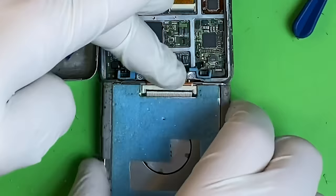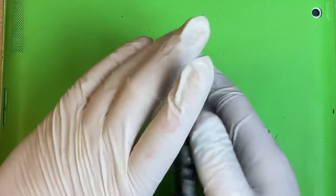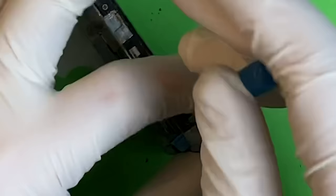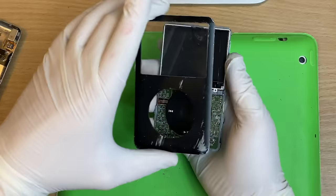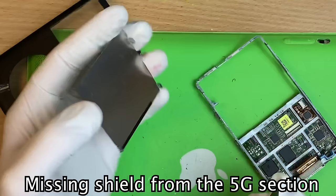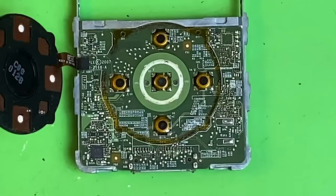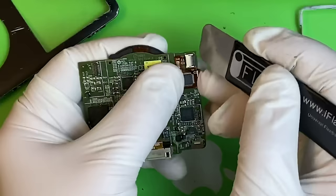This drive's a good one. Pull it down and out — don't lose those little rubber bumpers, they're important. Get the headphone assembly and hold/wake switch out. If you're only doing the battery and drive, turn around and stop here. But let's go all the way down — take all the little screws out. Let's pull apart the outside from the chassis. Don't get any fingerprints on the inside. Just disconnect the screen here, and all the weird metal business comes out with it. There are two little extra screws here, then the glue should let go. Take the click wheel off — it's glued down, so carefully peel it up and push out.